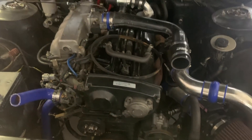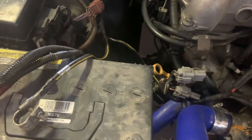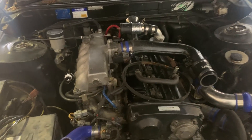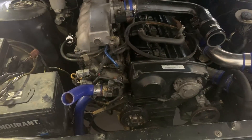We're going to be pulling this motor out. Already got the radiator out, alternator's off. All we've pretty much got to do is take all the loom off, cap all the fuel lines, undo the motor mounts, undo the gearbox crossmember, undo the driveshaft, take all the shifter boot and shifter out of the gearbox, and things should be pretty much ready to come out.